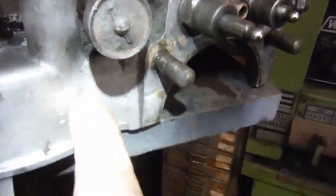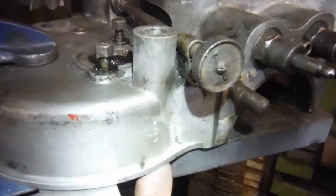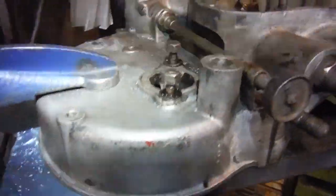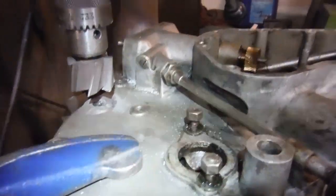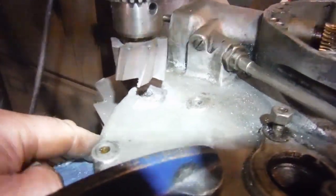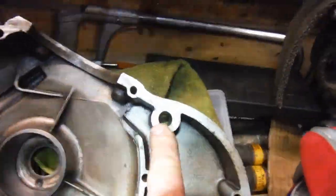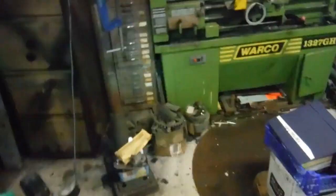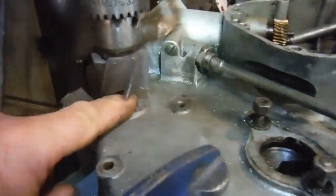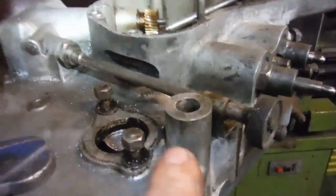These actually pass right through — they don't stop at the inner face of the crankcase, they go right through down as far as the joining face or gasket face. So they're like a sort of internal tube; this one will clamp hard against its partner internally in the other half of the crankcase. So there shouldn't be any worries about oil leaks or anything else, just because we'll have a separate piece replicating this — that shouldn't be a problem.